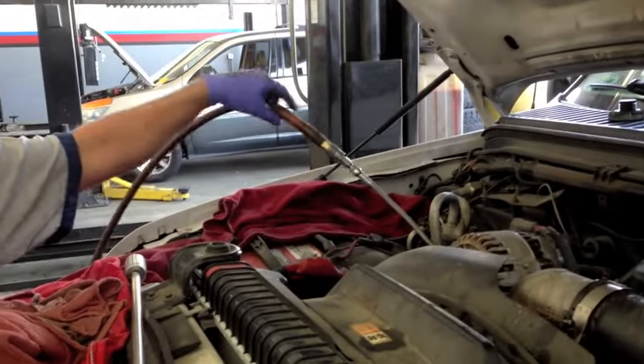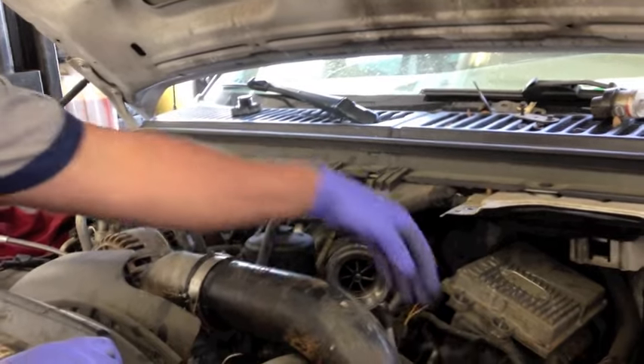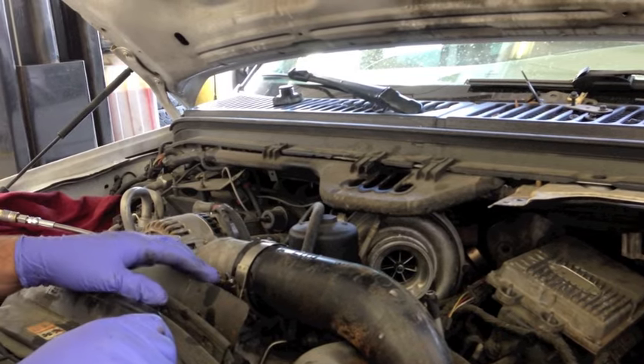On this one with the low ICP, what I've done is taken the low injection pressure — I've taken the ICP sensor out and injected air in it. You can get these online, cost about 30 bucks. You just put an air hose coupler on it and screw that in place of the ICP sensor. That's the easiest location on an '04 or up. If it's an '03 or early '04, you have to do it back by the reservoir. On this one I've got a custom hose made — just inject shop air in it. Take out the oil cap and listen. Take out the air filter and listen. I don't hear a leak, so I'm going to go out to the IPR valve and see what we get.